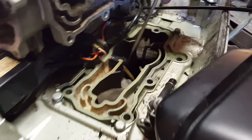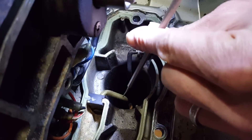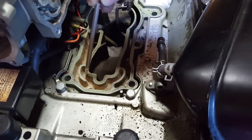First of all, this is the water tube right here. The water pump down in the water near the propeller pumps water up through this copper tube and through this grommet. The cool water then travels and fills this passageway.